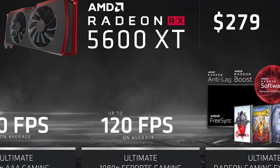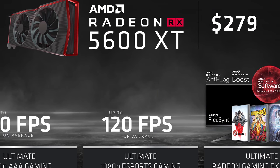Generally, the specs here do exceed the RX 5500 XT, with 36 compute units compared to 22, and higher memory bandwidth thanks to a 192-bit bus compared to 128-bit. But we will be in the unusual position where AMD's cheaper mainstream card is available with a larger frame buffer. The 8GB RX 5500 XT isn't a great buy at $200. It's far too expensive for the performance it provides, but it does have the extra VRAM that the 6GB RX 5600 XT doesn't. The only mystery surrounding this card going into CES was the price.